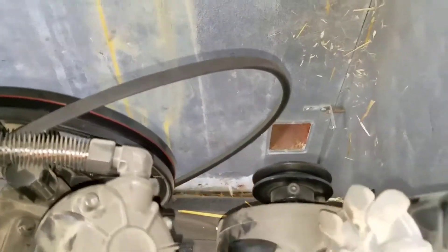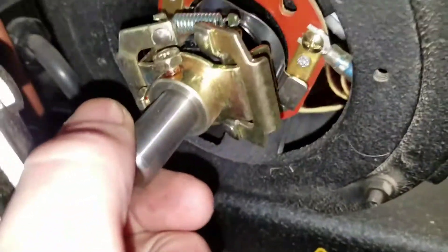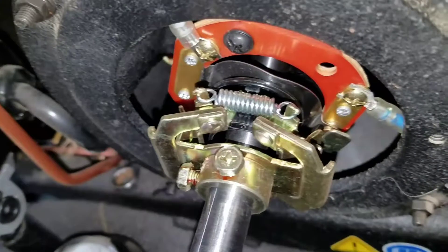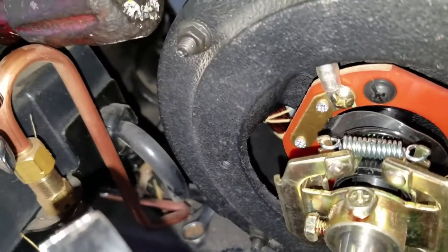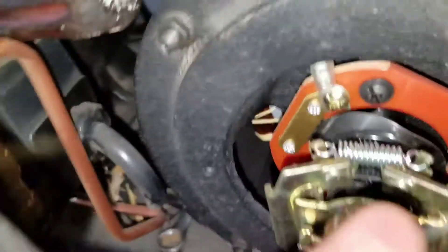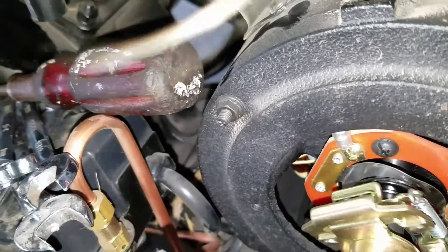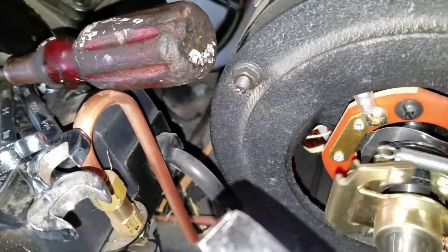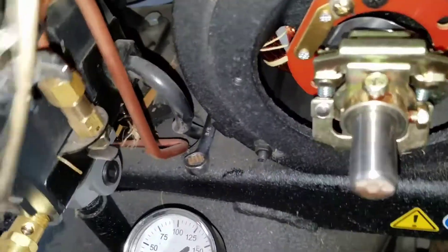I have the back cover taken off and the belt so there's no tension on it. What I'm going after are the contacts right in there. It's like a centrifugal clutch — almost a two-speed clutch. When it starts to spin, this will push up that metal spring and put it from high torque to low torque mode. I'm thinking it's stuck on low torque mode, so I'm going to get these two screws off and remove this.